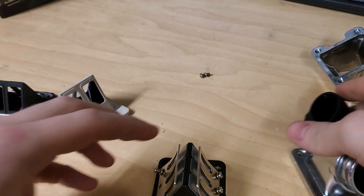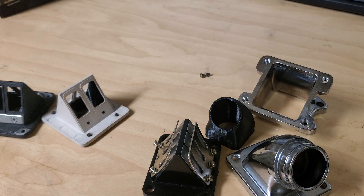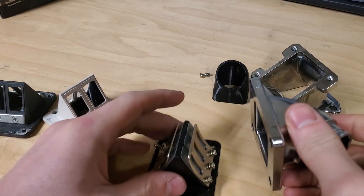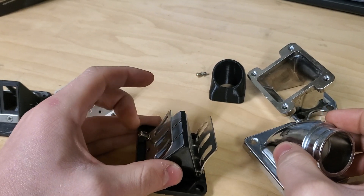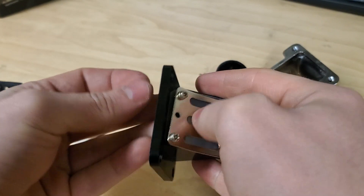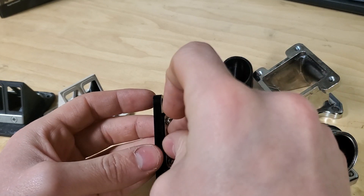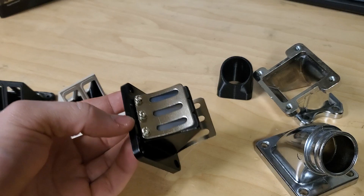You can see just how much extra space there is in these cages. One of the biggest faults with Dios is guys will have their bike all set up expecting a monster, and it ends up being a dog on the low end. That's because they're gasping for air — the carbs are so big and the Dios have so much extra room that air is being pulled from before the carb instead of through it. Fill up these Dios and you will notice a crazy change in performance, especially on the low end. Some people also report increased top speed, but these are really meant for low-end and mid-range gains.